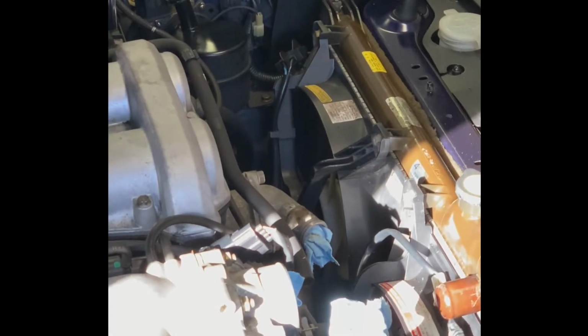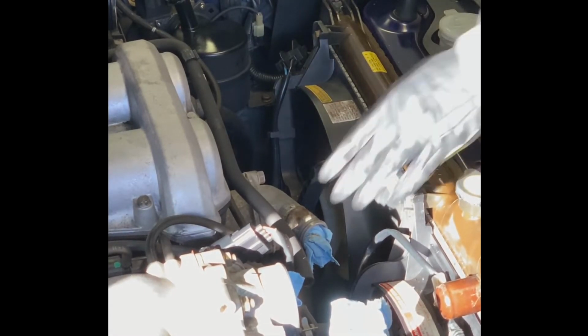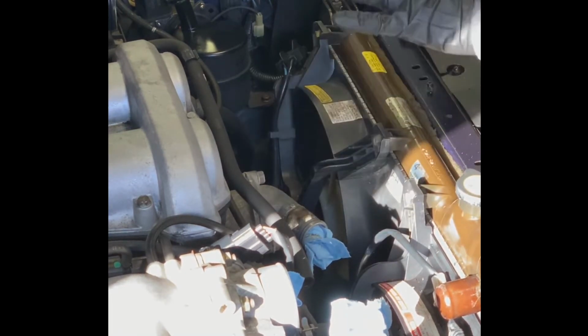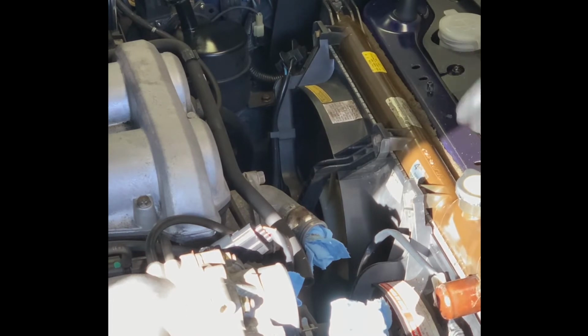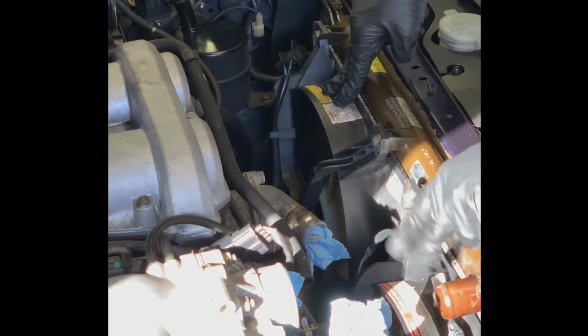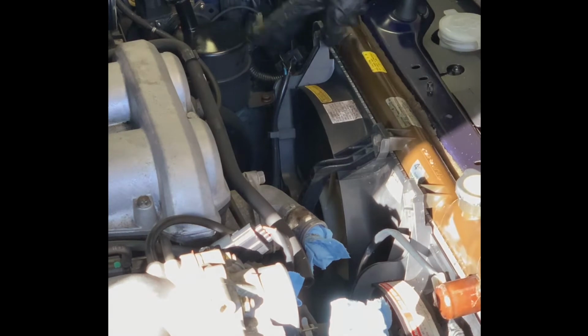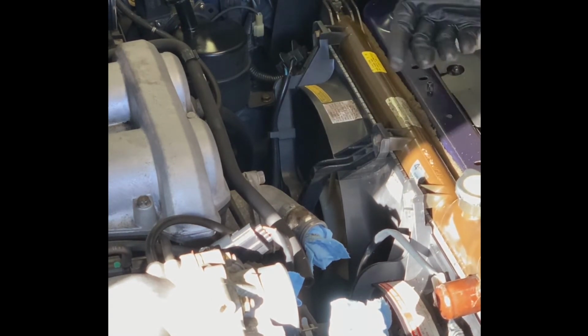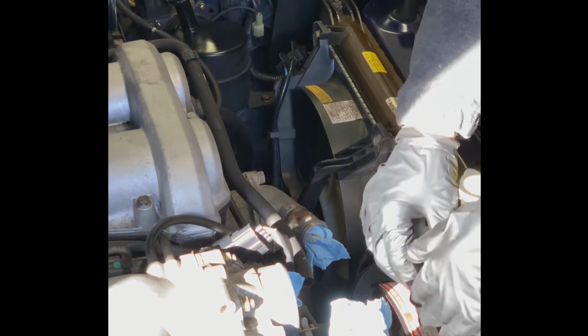All right. Moving stuff out of the way, kind of tidying up the spot. I went ahead and put some tissue up inside there, though the valve's shut, so that really shouldn't be necessary, but also to keep it from dripping any more coolant out. So on the radiator itself, of course, we have two fans. We got a large fan and a small fan. Each one has its own electrical connections, so we've got to get those off before we can unbolt anything, and it seems to be a good order of things.